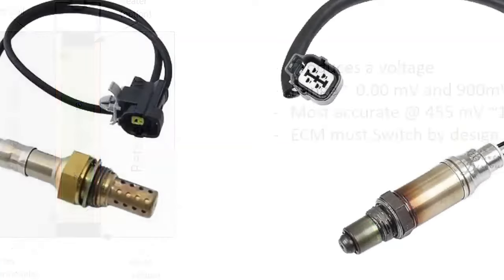So on an oxygen sensor, let me back up here a little bit. Oftentimes it goes through, say, like this crimp cap right here. It'll actually get in and get through that. So if it gets bent or damaged at the top, or maybe I might have some vent holes in the top, depends on how it's designed. But if I get a crimp, or it gets crushed, gets bent, gets hit by debris on the road, whatever it happens to be, or maybe the kid moving the exhaust up and down and trying to do a repair, that can affect how the oxygen sensor works.